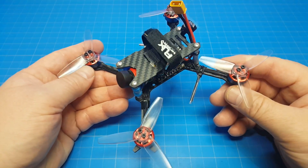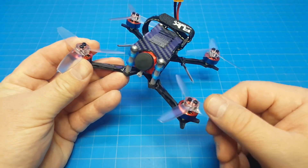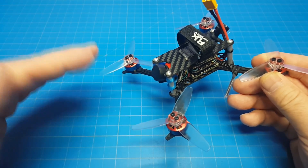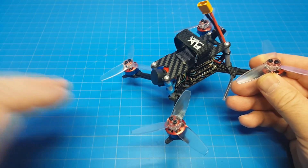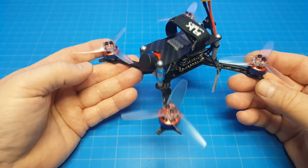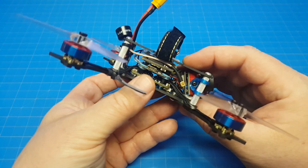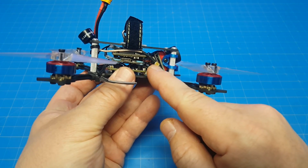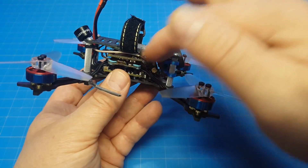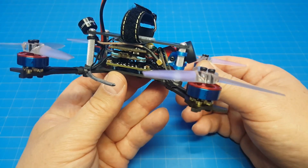This is the Retorius Zoot - you may have seen this in a previous video. I've flown it some. I may have built it too light - I may have to reduce the idle or reduce the prop size because I can hardly bring it down. Flying under canopy all the time, I need to be able to get down. I use motor braking to help, but I've got to be able to make those corrections. Getting down is always a problem with quads that have big motors, large props, and are lightweight. It does have a Caddx Turtle in it, which I'm excited about.